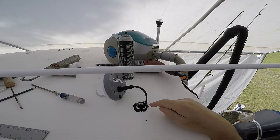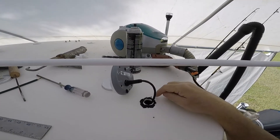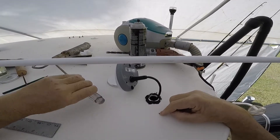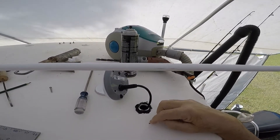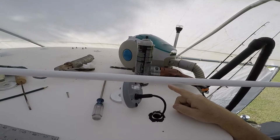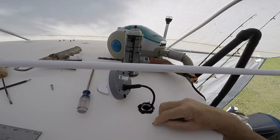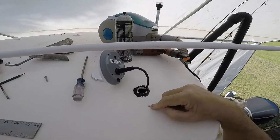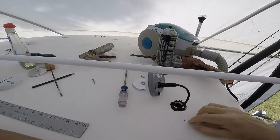We got our hole drilled and the wire attached to the compass. I drilled the mounting holes and tapped them with the screw. When you drill a hole through fiberglass you want to chamfer the top of the gel coat — I take a bigger drill bit, put it in the drill, run it in reverse, and make a chamfer on the hole. That keeps it from cracking. If you notice, when you buy a boat from the factory they don't do that, and after a couple of years you get spider cracks running off of the hole.